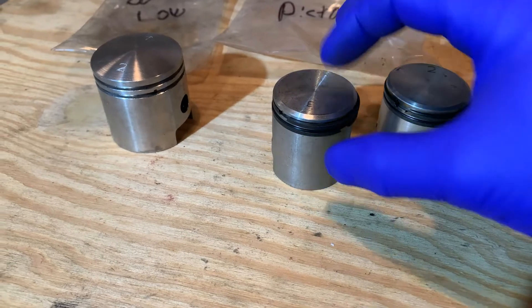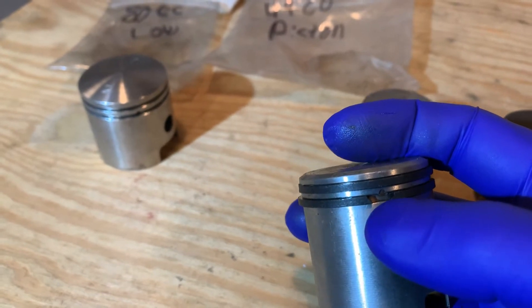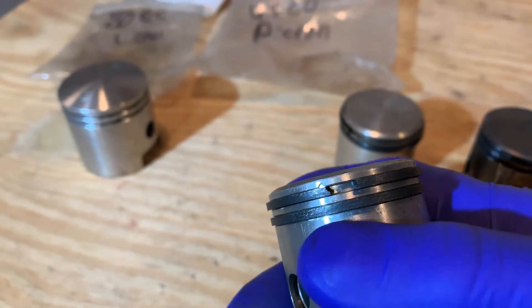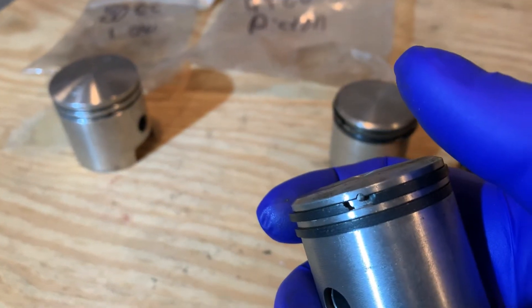This one — the three will be upside down on the intake side to keep the pins on this particular piston in the correct position. There's a little pin — hopefully you can see that little guy there.